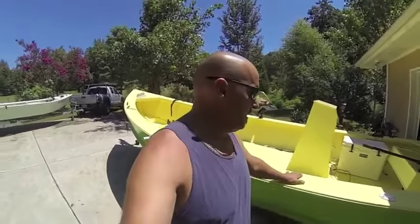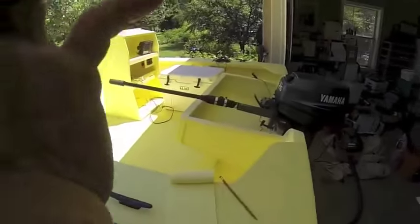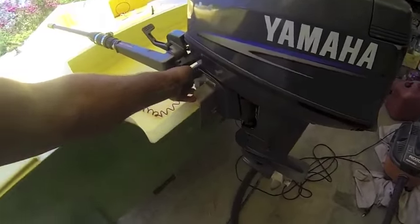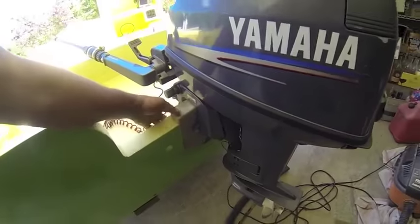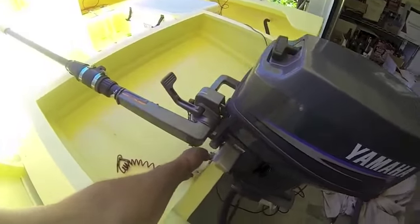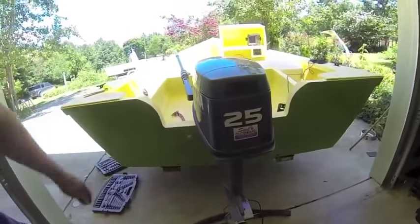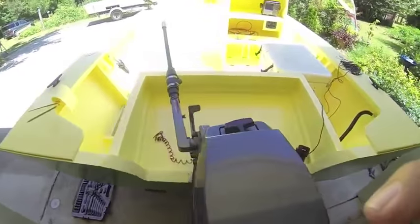So here I am — got the motor on an aluminum plate. This is stuff I have at the house; I don't have a clue why, I just see it, I like it, I keep it. It was plate I took, cut it off into shape, bent it, and then I had another piece. I've been up over the top of the transom, mounted the motor, through-bolted it.